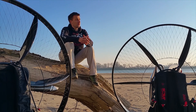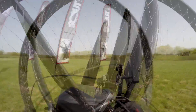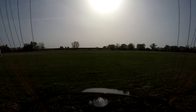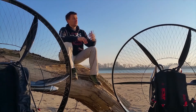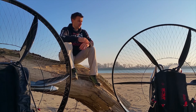But with dynamic torque compensation that we use at Scout, this is really different. We use these beautiful carbon spars that are shaped in an airfoil shape and act like a windmill. The more power you apply, the stronger the torque gets — but as well, the propeller generates a lot more airflow, so the compensating force of the spars on the Scout is stronger, and the compensation increases as well.